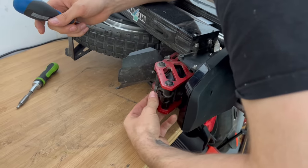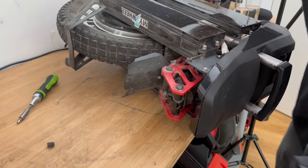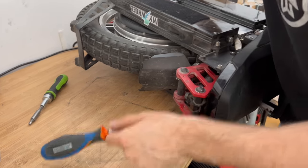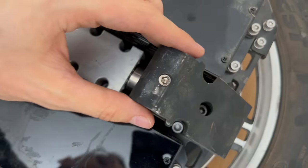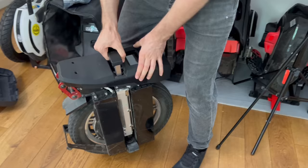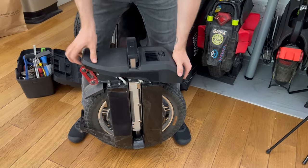To make the disassembly process easier, we'll also remove air from the air shock. The shock has been performing rather well — it has rebound adjustment and I didn't feel like it was leaking too much air. The middle part is what moves on the Begode Master when it comes to suspension. At the end of those sliders you can see a rubber stopper which prevents the metal parts from clonking together, however it's still a very strong clonk that I hear every time I bottom it out or the suspension fully extends.